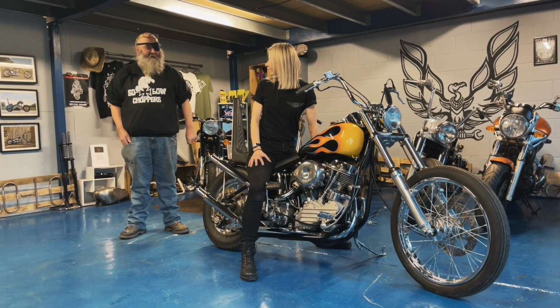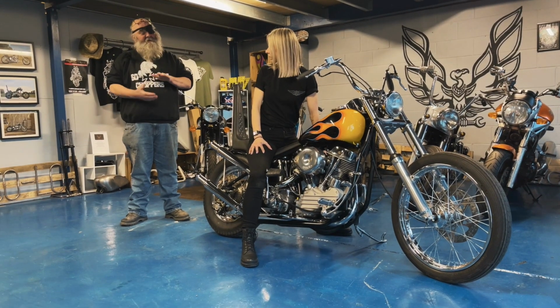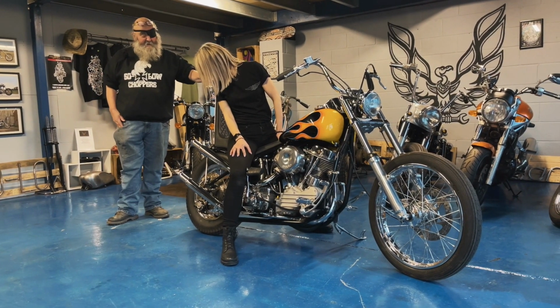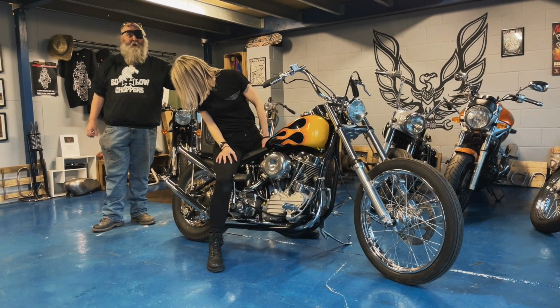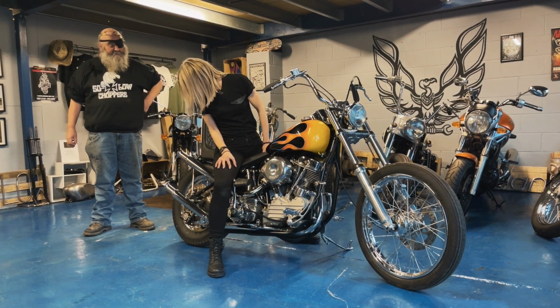We'll run the rear tyre pressure down to 22 to 25 psi, so you get probably an inch of suspension in there, really. Yeah, really. If you pump them up to 40 psi or something, that is really harsh. But we run them low, 25 tops, and then it becomes softer.